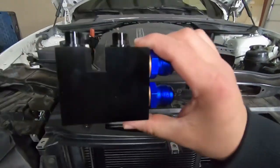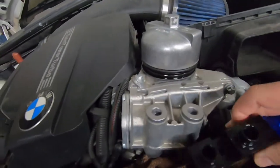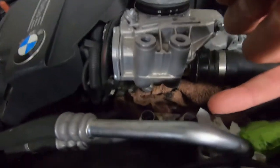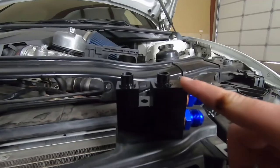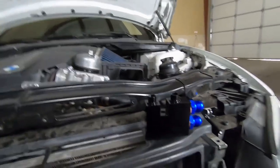This is our little adapter — it's just a little square block. This is actually going to go underneath the oil filter housing here, and it's going to plug into the bottom there, then run a bolt to where the old ones are. This is the old oil cooler line right here, and that's just going to go on the bottom. So how this works — they have two passages. One passage goes straight through and that's going to go to one oil line. And then this one actually comes down and comes out this line, goes to the cooler, and then comes back through this line, and then down to the old oil cooler. That way you're actually running through two oil coolers — it's not two separate systems, it's kind of one whole system with two coolers in it. So theoretically it's twice as much cooling.